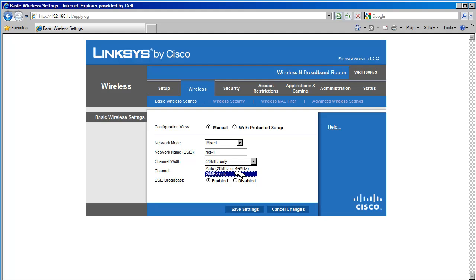Channel Selection is set to Auto. This allows the router to see what channels are being used by neighboring routers and will try to pick one that has the least interference. This is the recommended setting because wireless environments change all the time and routers are added and removed constantly. Leaving the setting to Auto allows the router to choose the best frequency as the environment changes. If you want to select a channel manually and are configuring a 20 MHz channel, then select channels 1, 6, or 11 because there are no overlapping channels. We are going to leave this setting at Auto.